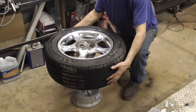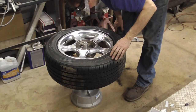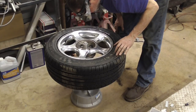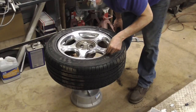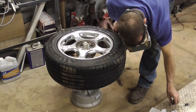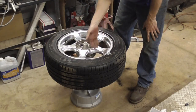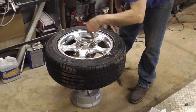To balance the tire, just set it on top of the balancer, then get a good view directly over the bubble and press in certain spots, trying to get that bubble to go exactly in the middle. There's one spot that's going to make the bubble go directly in the middle — right about there. I'm going to start with one ounce — put that right there. Looking directly at it, it looks like it needs a little more, so I'll do a half ounce, and that looks good. Now I'm going to clean up the back side of the rim and stick these weights to it, and I'll show you how to get these directly in the right spot.